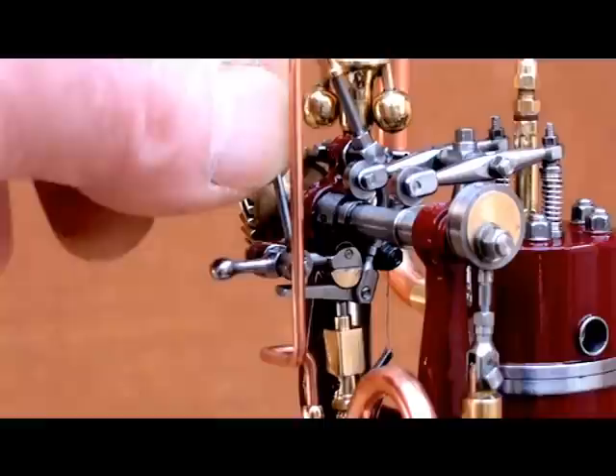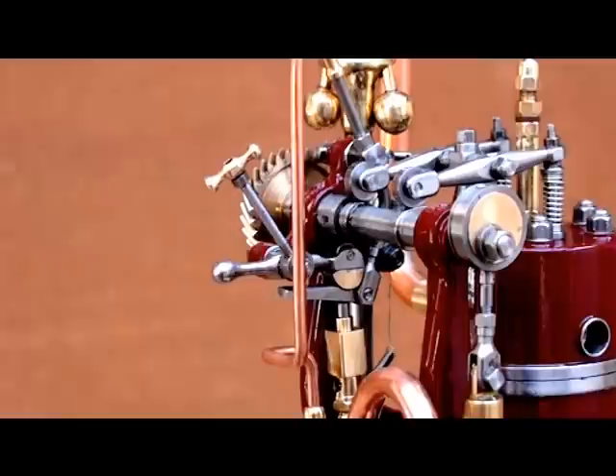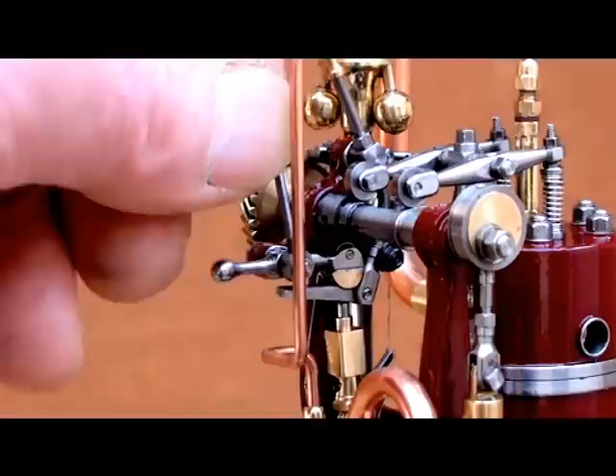So, when the handle is activated, it moves the injection pump handle in and out, and thereby changing the time when the injection pump cam hits the handle and thereby the injection pump. So, an earlier or later injection time can be found.